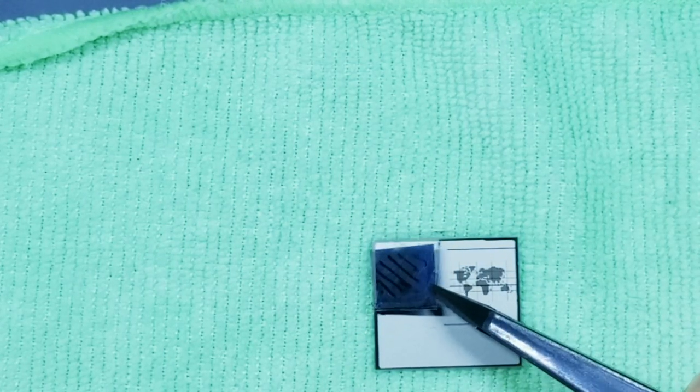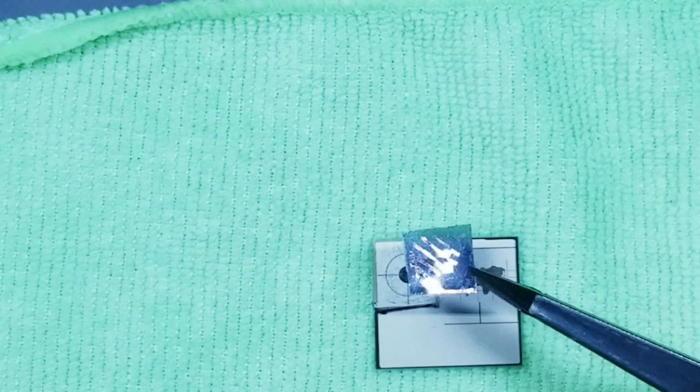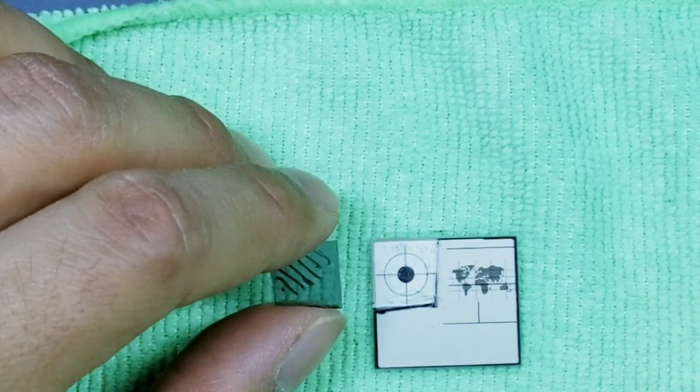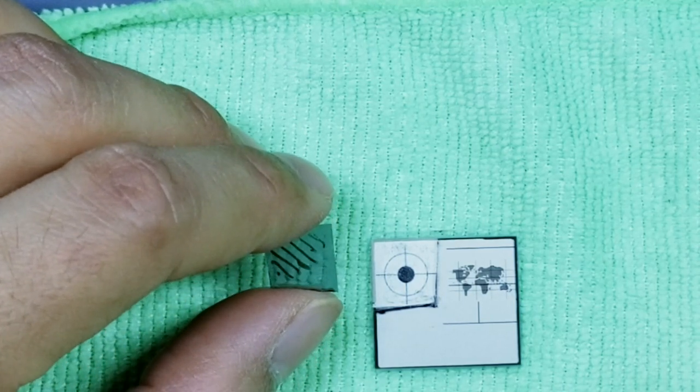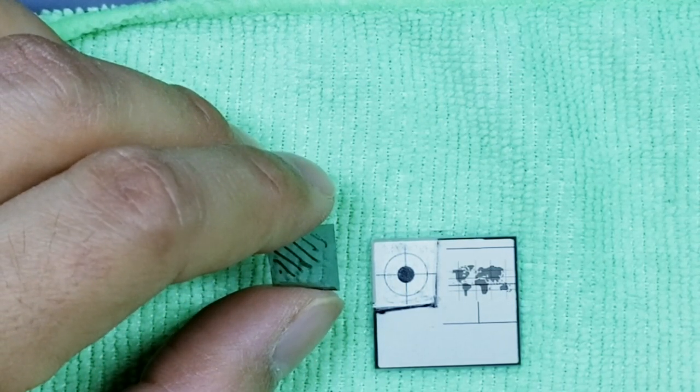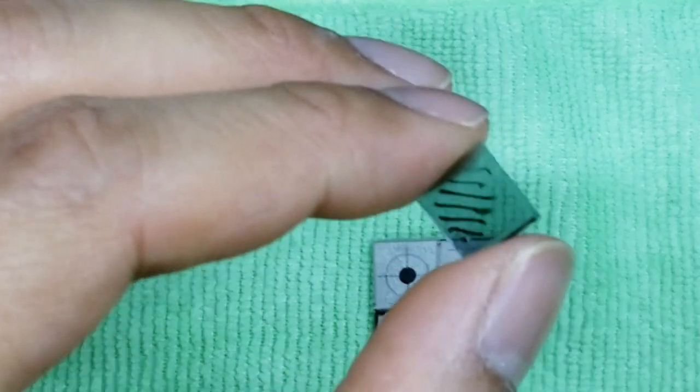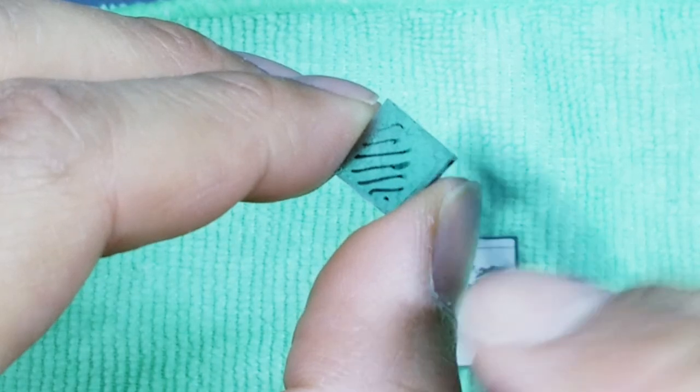And there's that black. Okay, so you need to make sure that when you cut out your new polarized filter, it's on not only the correct orientation for 90 degrees, but it's also on the correct side. And I'll show you how. But you can see here, this is filled with a lot of gunk, a lot of glue. That's why it looks completely cruddy.